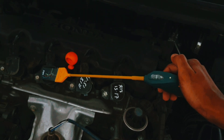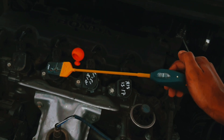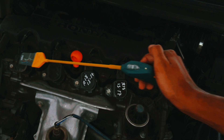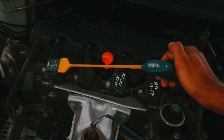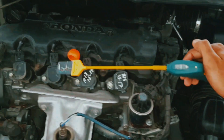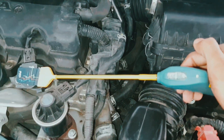But this one is not working — you can see here, this ignition coil is damaged. Not working. And that one — the fourth one is perfect. That means number two is not working. So number two is damaged; three and four are working.